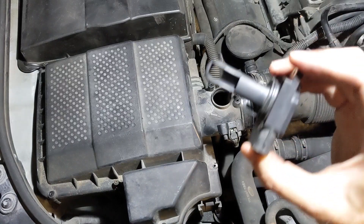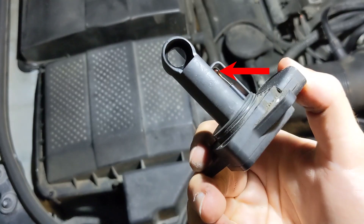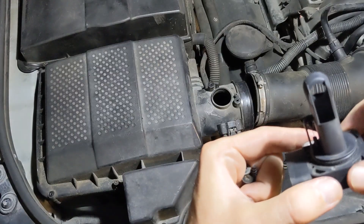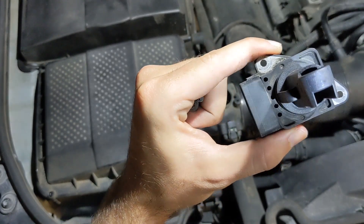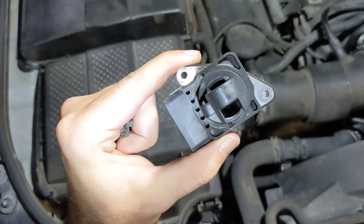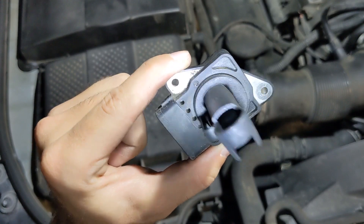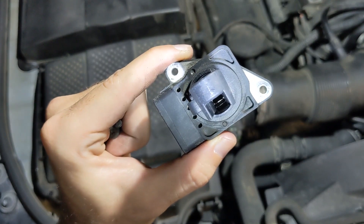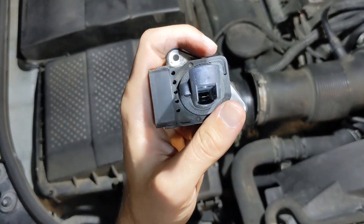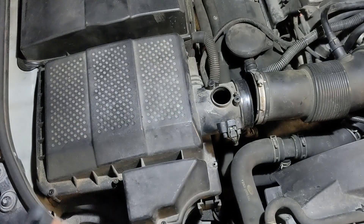Here's what the mass airflow sensor looks like. You can see the intake air temperature sensor here. Since cold air is denser than hot air, it's important to know the temperature of the incoming air so appropriate corrections can be made in calculating the air volume. A portion of the intake air flows into the hot wire area — air literally blows on this hot wire causing changes to its resistance, current, and voltage. The voltage is then sent to the car's computer to help with calculating airflow. The reason the wire is secluded in this plastic housing is to avoid being struck by debris that could damage the sensitive wire.